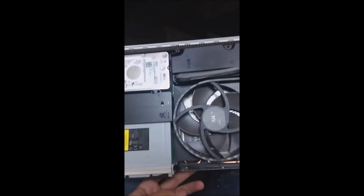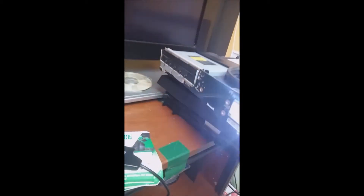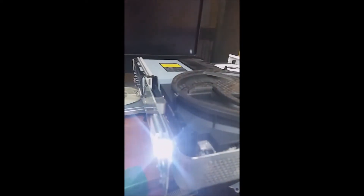If we take a look at the port itself, it does not look damaged at all, but if you do a wiggle on the screen you do get an issue. Let's do the screen test just to show you what I'm talking about. Okay, we have it hooked up to the TV. Let's power it on. The TV is on and you get this little message — 'no signal' — and if you move it to the side it says 'an incompatible video signal.' So if you shake it around there is intermittent connectivity and disconnectivity, which tells us the port is bad.